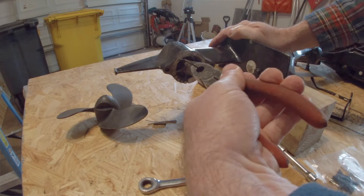As you can see, it's really not in that bad of shape. What you're looking for with an old impeller is a lot of deformities — because the way they sit in here, they squish towards one side, and that's how they push the water. Some of these fins look straighter than others, but the curve is settling out because it's been sitting for a few months pressed like that. Over time these things can get hardened, and when they come into the wider space they don't actually rub against the wall like they should. So you're looking for cracking, bits missing, hardening, or fins that are all twisted and staying in that position.